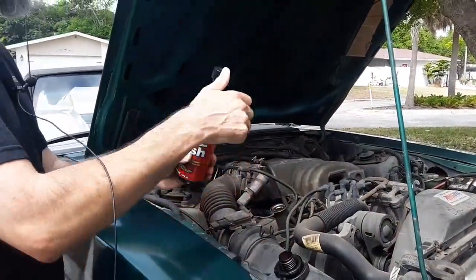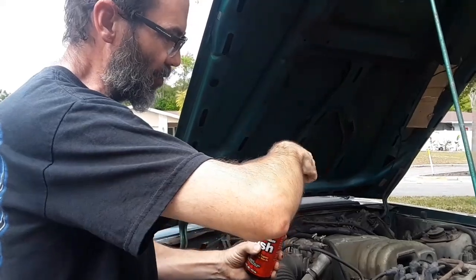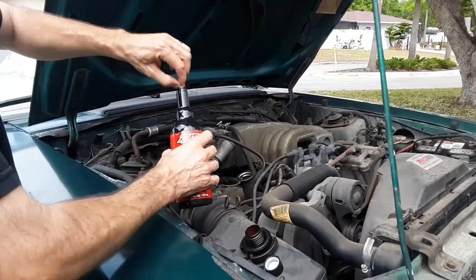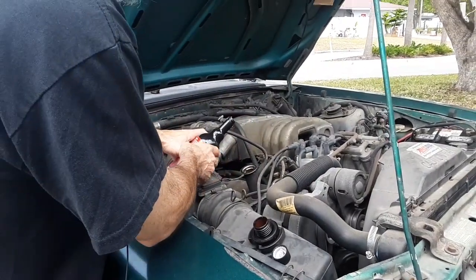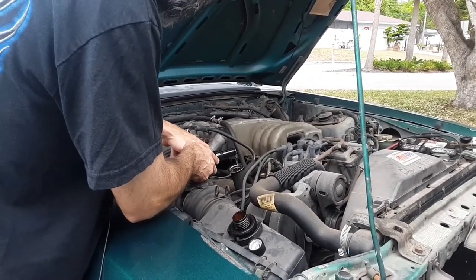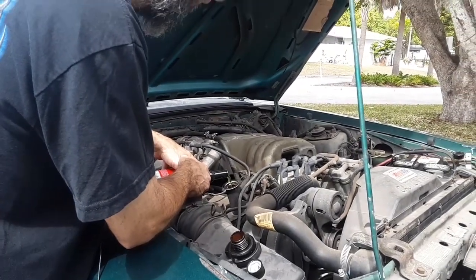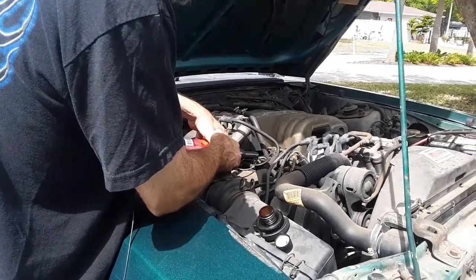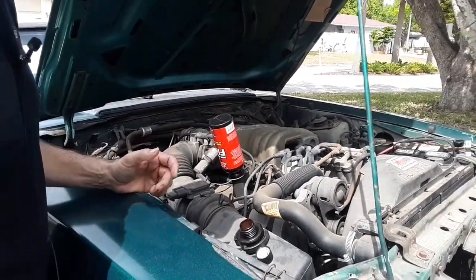So if you go back to my videos, you'll see that I was running the Amsoil 15W-40 heavy duty diesel and marine in here. And in some of my other videos, I talk about why I used to run such thick oil. I guess I came from the camp where thicker was better. I used to actually run 20W-50 in the car, but I've since changed my opinion, and so I'm going down to the 10W-30, which is a lot closer to the 5W-30 that this car recommends.